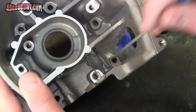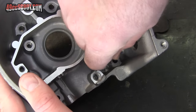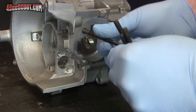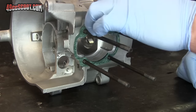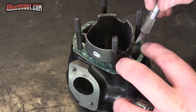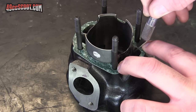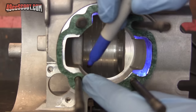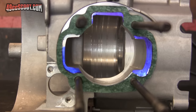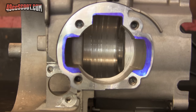After the filler was cured, I just ripped off the overhanging masking tape. You can see that some stays between the case and the filler in that small area, which is why you don't want to tape off too much. Then I bolt my cases together and install cylinder studs and the base gasket. This lets me see and mark any mismatch between my cylinder and the cases. It's important that the gasket that you use for this is well matched to the cylinder, so make sure you check how well the gasket matches before this step. You can use an exacto knife for gasket trimming if needed, and some gasket materials can be quickly modified with a burr and a rotary tool. Mark the area that needs to be cut away — I used a permanent marker, but you could use layout fluid and scribe outlines onto the cases. Unless you're building a race engine or a 90cc plus from a 49cc, you probably won't see anywhere near this severe of a mismatch.